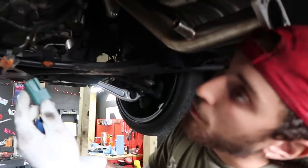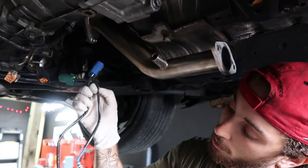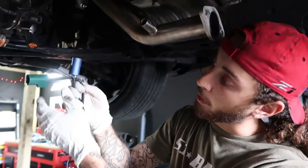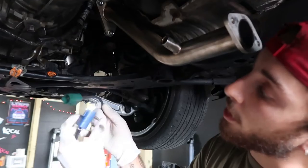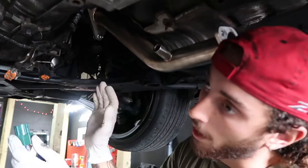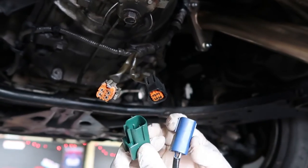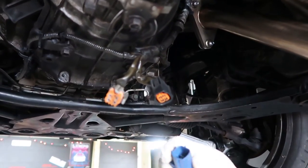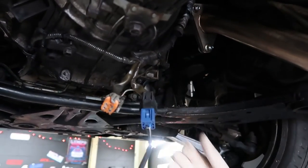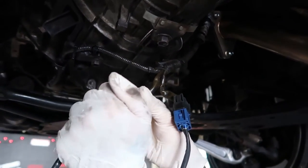What I just figured out when we were trying to install the O2 sensors on Ali's VHR test pipes — we've obviously got two sensors, but I wasn't sure which side they went to. Just in case you guys have this issue when installing new test pipes and putting back your O2 sensors: the plugs themselves won't fit interchangeably — you get a green plug and a blue plug. Green is for the driver side, blue is for the passenger side. We got our two sensors in — awesome.